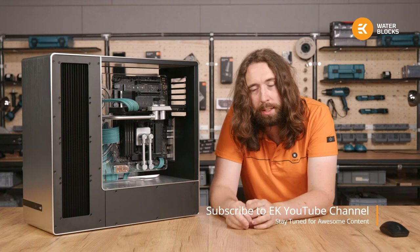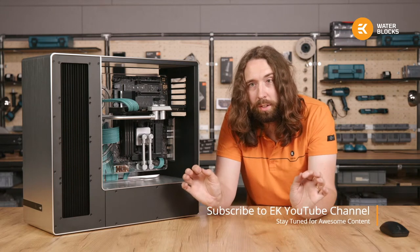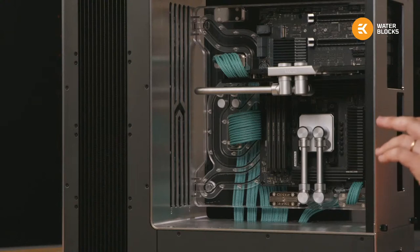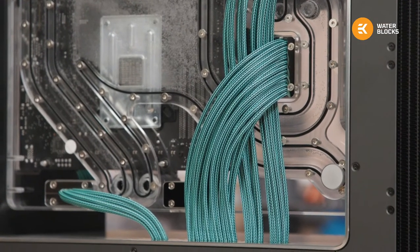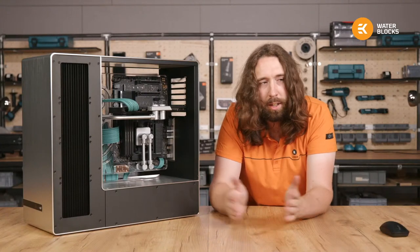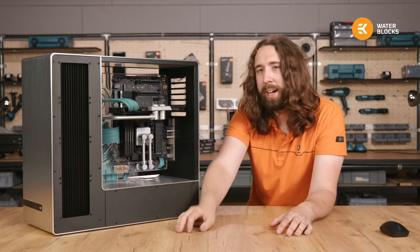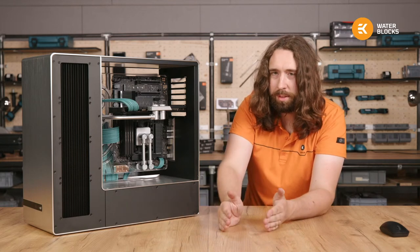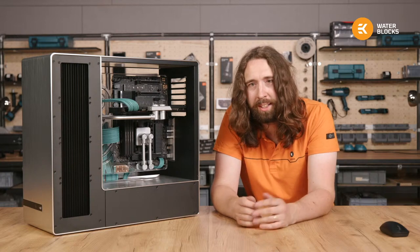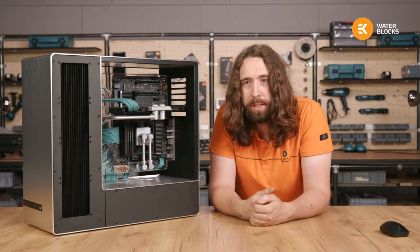So you need to be really delicate with every operation so that you duplicate wires perfectly. Make one, if you're trying to make an 8-pin EPS, for example, and all 8 wires are the same length, then cut one and copy the same one. Don't cut one, cut the second, and then copy cable 2 to make cable 3, and then copy cable 3 to make cable 4, because you will have an incremental deviation, and your last one could be shorter or longer. And then if you do that again when you cut the sleeving, then you'll find that you've made all the sleeving random versus your wire length, and then you put it together and you end up with a completely wobbly cable that's doing its own thing. So yeah, just learn the materials, work with them, and then try and be as consistent as you can.